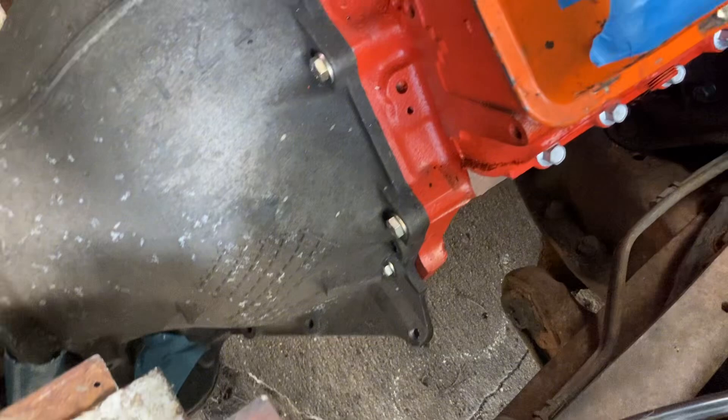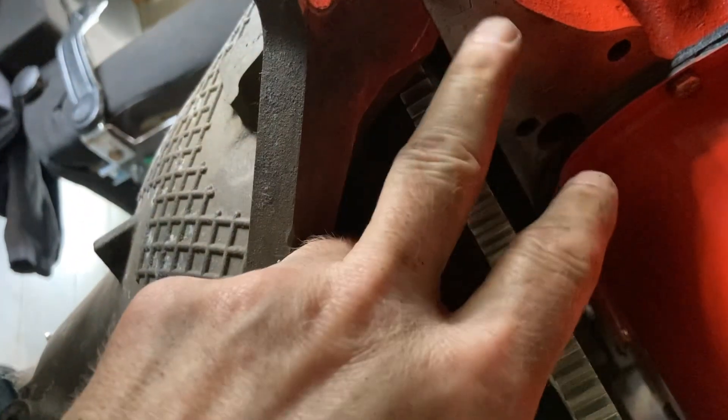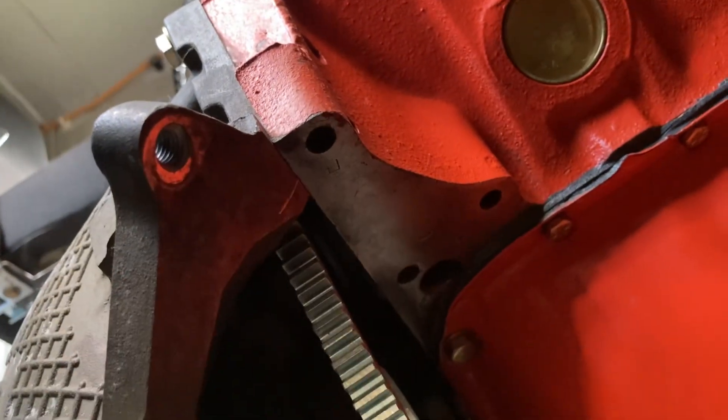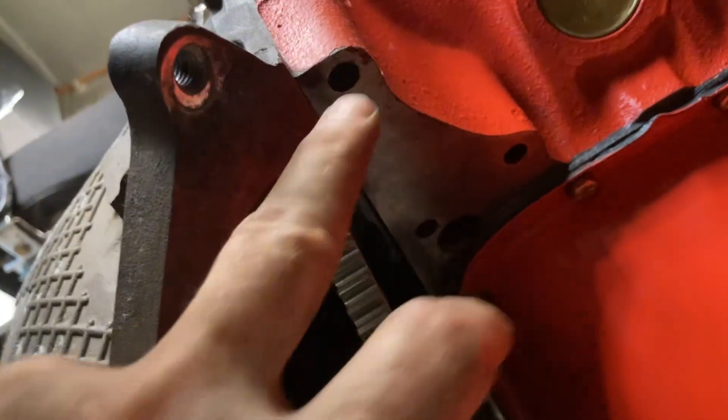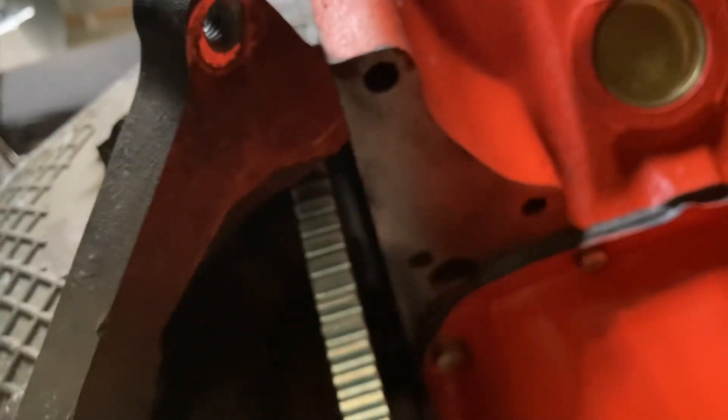The other thing is I need to figure out the starter. The old transmission, the 465, had a starter that went into the bell housing itself. So the problem is I had to use a different starter. You've got these parallel stagger bolt patterns on these starters. For the old small block Chevy, I think it's staggered — which is what would be on this one. I'm actually drilled and tapped for all three holes, so it didn't really matter as long as I have a good soft-mount. I hear one way is better than the other because it keeps from deflecting, though I don't know if that's a big issue.